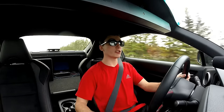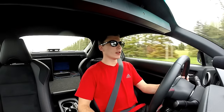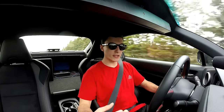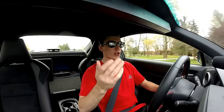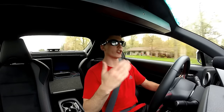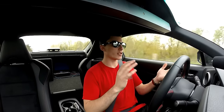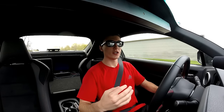Number two is don't use your clutch to hold you on a hill. Now, I'm guilty of this. When I first learned how to drive stick, I learned on newer vehicles that had hill assist. I didn't even know that was on there. I just never really thought about it. I started on a hill, I let off the brakes and the car held, and I just got used to it. Then I started driving this car and I started letting the clutch out a little bit, holding my spot, and then I realized it's not good.